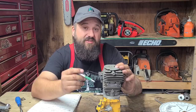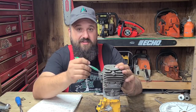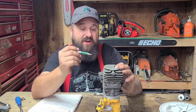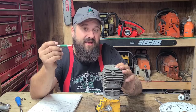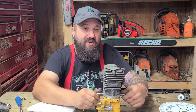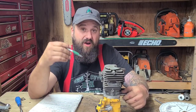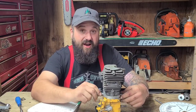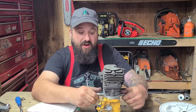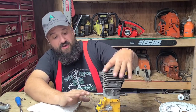If your combustion chamber pressure exceeds your transfer pressure, your exhaust pressure wins — it's not going to allow the transfers to flow. With 10 degrees of blowdown, when you bury this saw in larger wood it tends to go a little hot and a little lean. To me that's short blowdown. I don't like short blowdown saws — they feel really zippy because you're getting the cycle started sooner, but 10 degrees I think this saw is fighting itself.